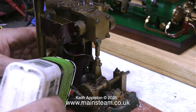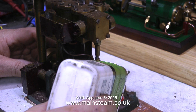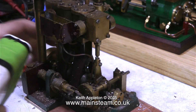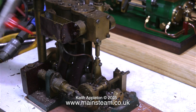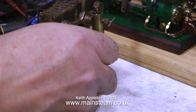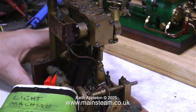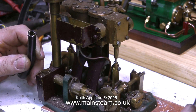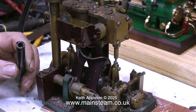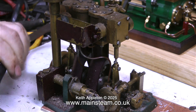The most important part of this boat is the engine. This one looks to be good to me, but I can't tell until I run it, and obviously it hasn't been run for a very long time, so I'm flooding it with machine oil. I will be using some of my other special oil, but I need to use very thin oil first to make sure it penetrates down into the bearings, particularly if they are dry or gummed up with residue. I'm also putting some oil into the pipe to make sure that the cylinders are lubricated — it would be very foolish to run the engine without lubrication in the cylinders.